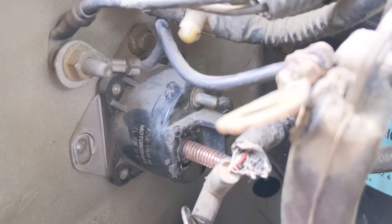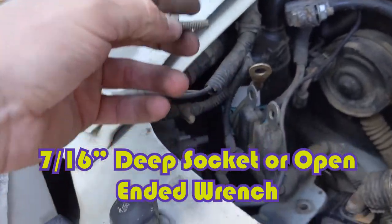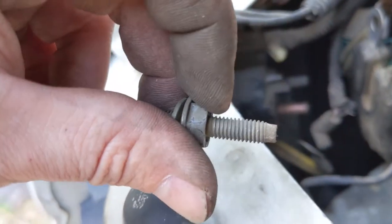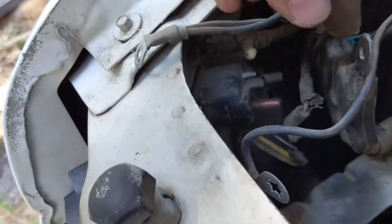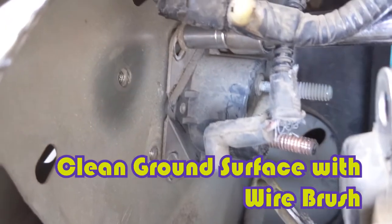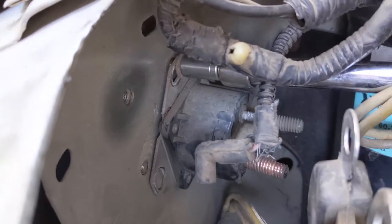It's just something you're going to have to do — it's really hard to reach back in there with a wrench and get the leverage you need without getting that ground out of the way. Here's that ground: one side screws into the actual chassis, and the other side is stagnant for when you put the nut on to attach the second single cable ground. This is a double cable ground on the back side actually attaching it to the chassis. I'm going to clean those up to make sure I've got a good ground connection. For the top bolt I used an 8mm with an extension.